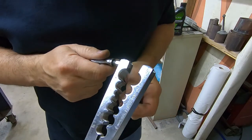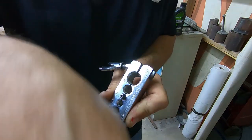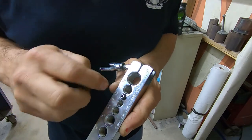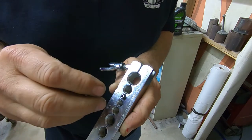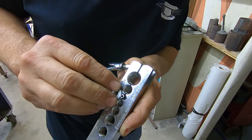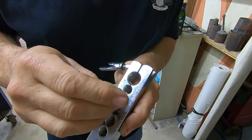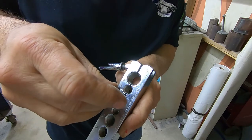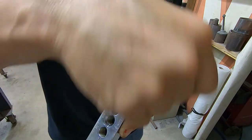All right, so over here in my vise, you know, they make really nice flaring tools, and I'm not advertising this as being nice. This is what has been out there for many, many years. So to set this up, first I always make sure, and I just use like a quarter inch drill bit, and I chamfer the inside of that brake line itself. Then I use my double flare part of the tool, and I hold it up here and I make sure I'm really close to having that brake line protrude the same thickness as that little piece is. And what I've found is if I'm just a little bit shorter, and I mean I'm talking probably like 20 thousandths shorter, with my amount of stick out, that I get a good flare pretty much every time.